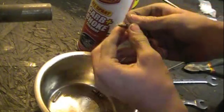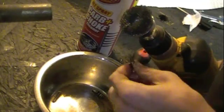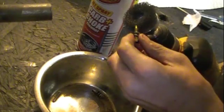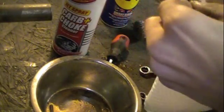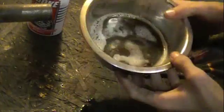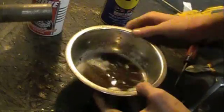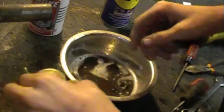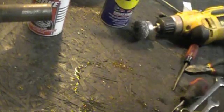Now you want to take your main needle — you can take your drill and kind of clean the top of it really lightly. Do the same for your idle mixture jet. For your needle, all you really have to do is just kind of wipe it off and make sure it's clean, because there's usually rubber on the tip of it and you don't want to wreck that. I've got some solvent here — I use my solvent a lot and I'm going to have to filter it; usually I run it through a coffee filter. Just throw all your small parts in there and let them sit.